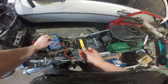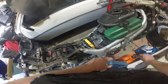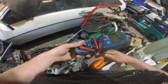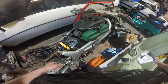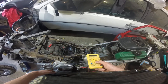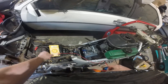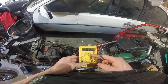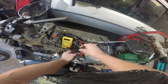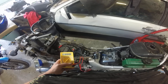The other way to do it — I have to change multimeters here because this one doesn't do AC. Put your multimeter onto AC and just stab it in there and see what voltage it makes. Because before the regulator rectifier it's unrectified, so AC voltage, and it's unregulated, so it's anything that it makes. So it's on AC with the little squiggly line — alternating current. Just stab that into two of them and then fire it up and see what it does.